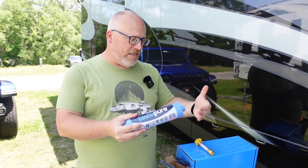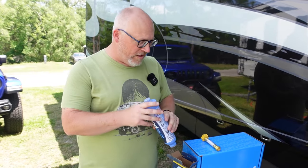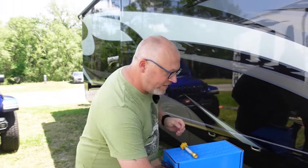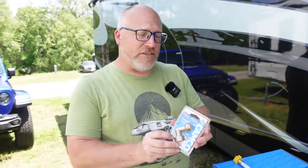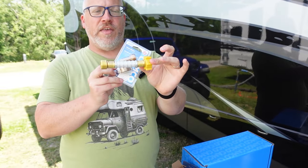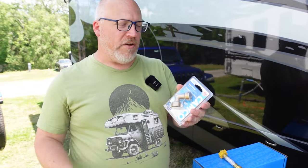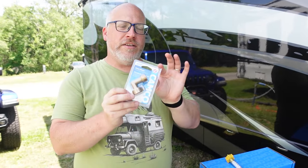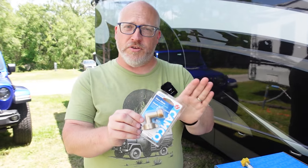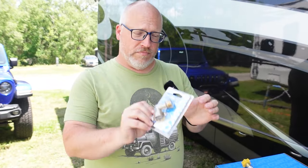The filter is on the other end of the hose in the wet bay, and then I have another short little hose in there that gets it connected into the spigot. On the other end of that hose you'll find something like this — a brass elbow. I have these in my wet bay; I use them as strain relief so things come out and immediately turn. I've used them on all of my RVs and they're great. It keeps things from hanging out at a funky angle, helps keep things close to the closing door, and you don't have a big filter sticking straight out of your rig. Elbows are super affordable and super useful. Just make sure any elbow you buy is all brass, all lead-free, and all drinking water safe.